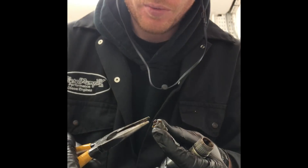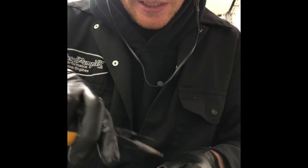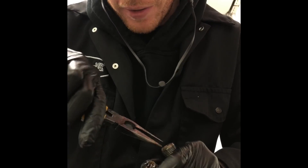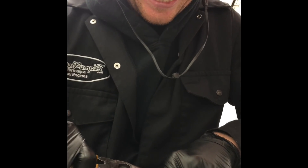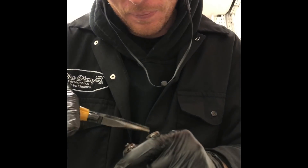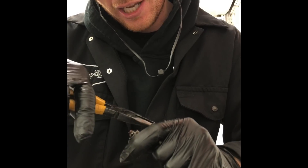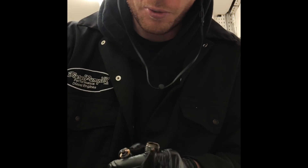That is normally just meant to be a very nice fluid fit with an excellent seal — that is literally horrible. The spring won't come out either. Look at that — that is absolutely horrible. All the inside of this delivery valve is affected, and there's a very good chance that a lot of this will have to be thrown away.